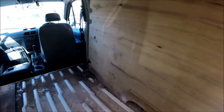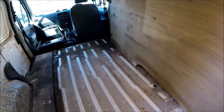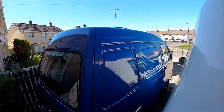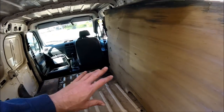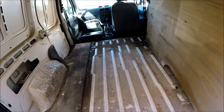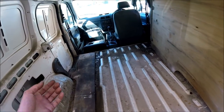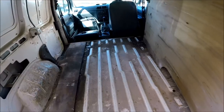The floor is going to go back down — it's in good condition. Then I'm going to insulate the actual ply. I'm going to use EVA foam mats, similar to what I've done in my little HiJet micro camper conversion — that should be all documented on my channel. The EVA foam is going to go on top of the ply, and then I'm going to get some Altro safety flooring which will finish off the flooring and give it a nice hard-wearing finish.